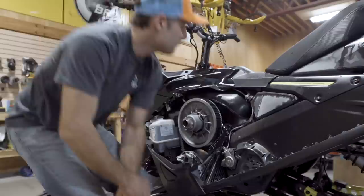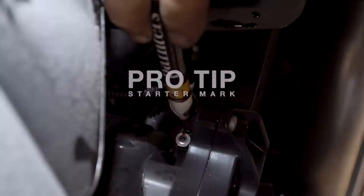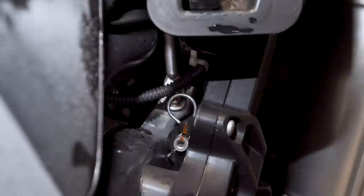So if we go around the other side I'll show you where to turn it. There's one trick we do when you're checking chain tension — this kind of comes from the race world. We mark everything. I mark the bolt and the case, so now I can tell how many turns I'm turning.